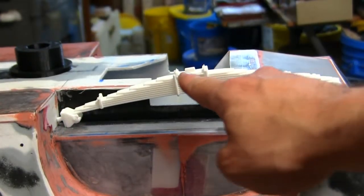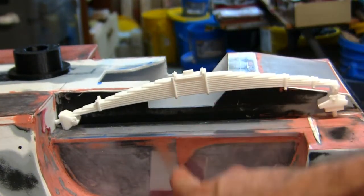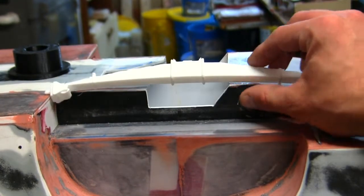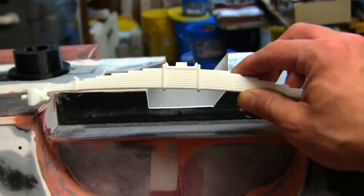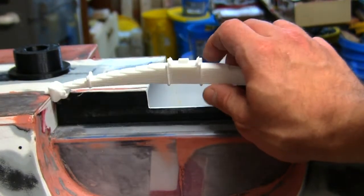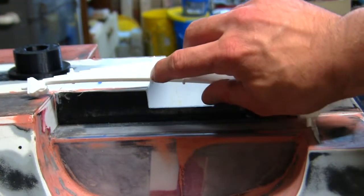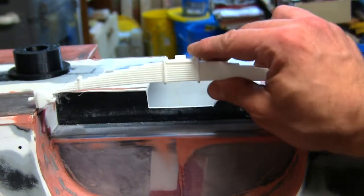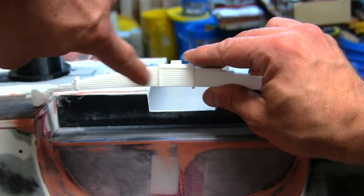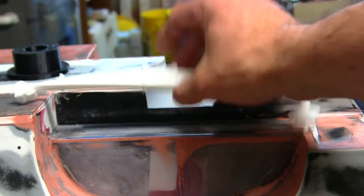The first modification we're going to make is to get this section more centered with the rear differential well. Now, the way this is going to be done is, luckily, with the way the leaf spring is designed, we have these two bars that come across the section here. Well, one really easy way for me to shorten the length is I'm going to go ahead and make an incision on this portion over here. With this unit removed, I could remove the amount of material necessary off of this section in order to get this corner closer towards the center.